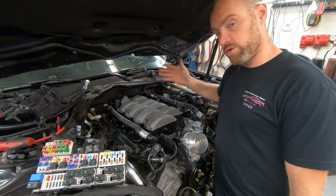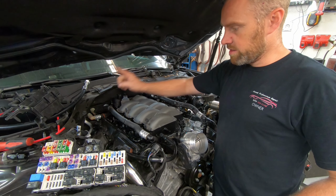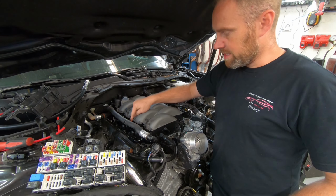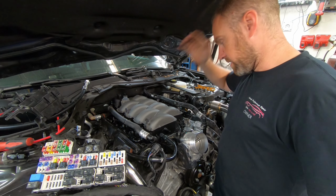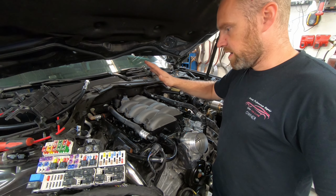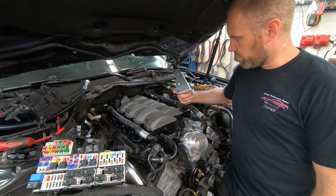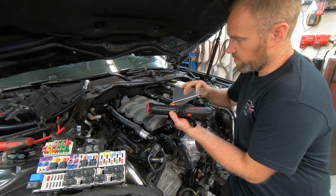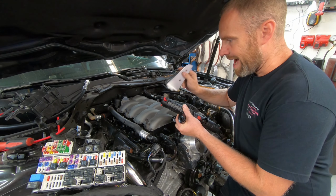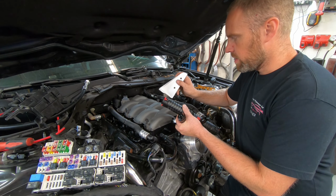Now, normally when I do a fuel system, I don't know how On3 wants it done. I do know that I need to feed the high pressure pump and I need to feed the low pressure rails. So with that in mind and the fittings I have available, On3 has a couple of brackets. They look like this. Now, these 2 holes right here fit the regulator perfectly. Now, there's 2 of these brackets. However, I do not know where they mount, nor do I really care.